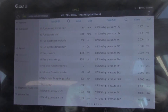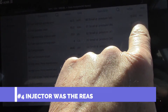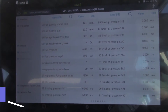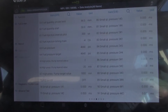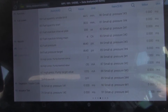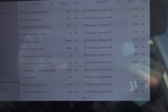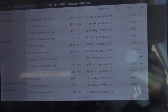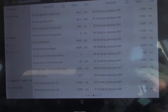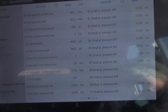Just out on my road test I thought I'd pull over so that you could see the small quantities there. Even number four has gone back to zero because we've recoded the injectors. This will take a little while before it relearns itself, and of course I've got to do the small injector quantity relearn. At the moment yes the check engine light is still going hell for leather, but I'm not overly concerned because this all has to relearn itself.